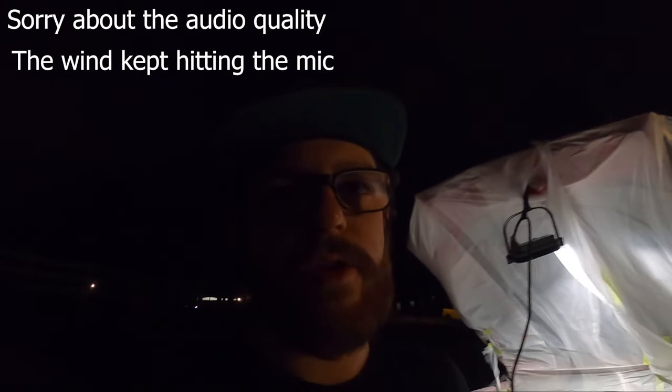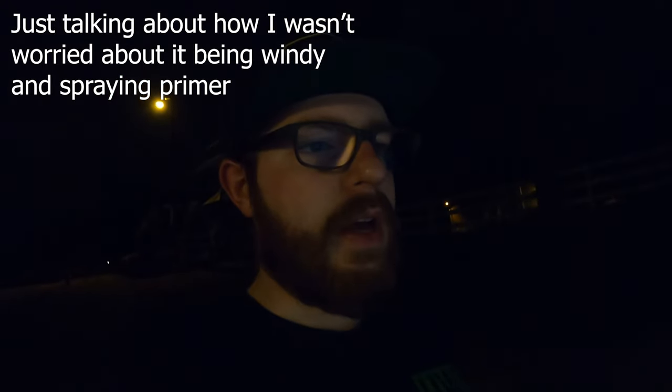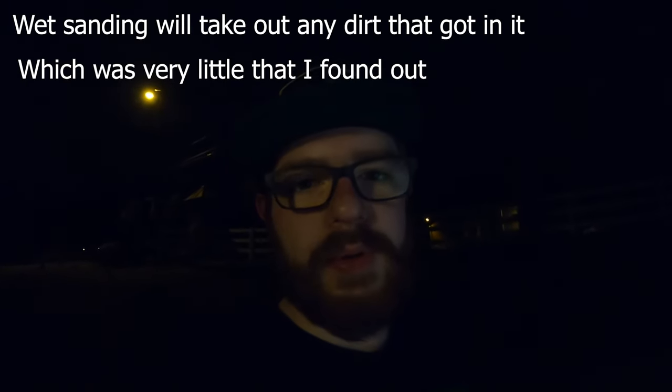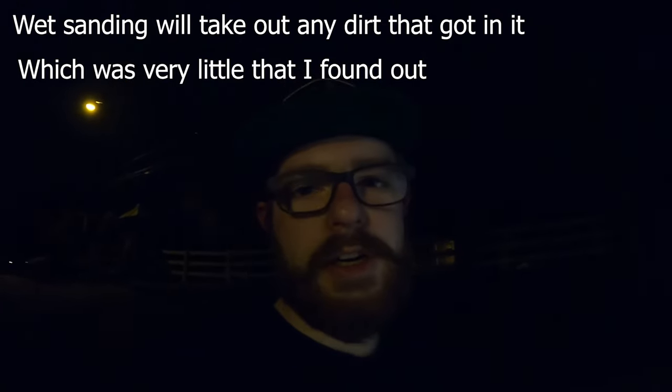Yeah, I wasn't too worried about it since it's primer and like all the wind and everything. I am going to be doing a light wet sand on it to get it ready for the color and clear.